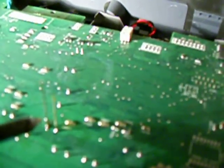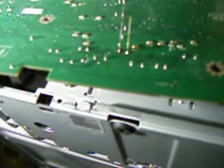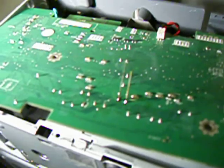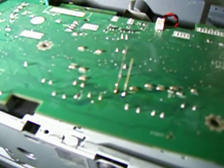You insert the new capacitor in and push it all the way until it bottoms out on the board, with the leads sticking way up. Then gently put the soldering iron on the lead of the component — I give it a good two to two and a half seconds until it liquefies. Dab that with solder, then slide the soldering iron down and touch the board, heat up the trace, and hopefully solder just flows to the trace. Your hope also is that solder flows through to the other side of the circuit board and makes contact with the trace on the opposite side. You want to do this fairly quickly — if you're holding the soldering iron on there for more than five seconds, you're at risk of damaging something. You can go back over the same spot and add a bit more solder or correct a messy job on a particular lead.